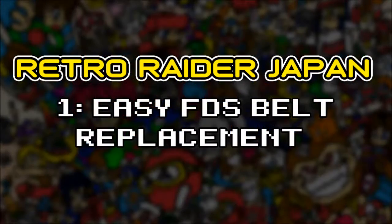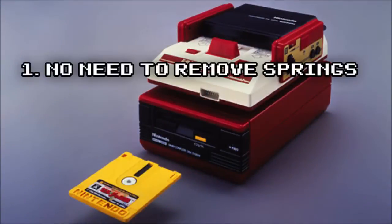This first video is a tutorial on a new, much easier and faster method of replacing a drive belt on a Famicom Disc System. Unlike all the other tutorials out there, there's no need to remove the four springs inside the drive, as we're not going to mess with the spindle too much. If you overstretch or lose one of those springs, it's close to impossible to cheaply find replacements of the exact same size and tension.